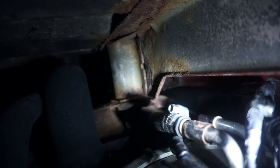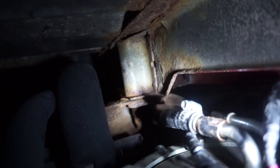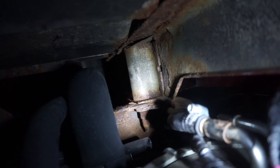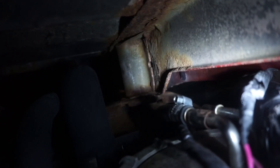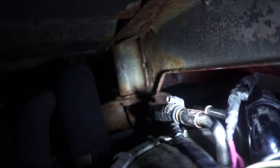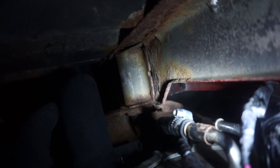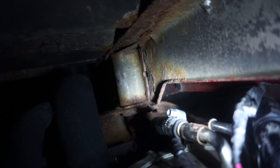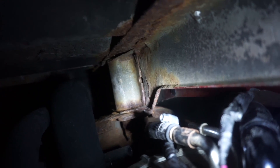What I did here — there was a 5/16" on the other side. I took the return line and put it back on the 3/8" side. I clamped it down; it should be good enough temporarily. What I'm going to do now is go test the fuel pressure, because it's on the 3/8" side now, not the 5/16" side. Before, I just took that 3/8" hose and put it over the 5/16" barb — it went right over, jammed it on, clamped it down, and never thought about it again. That might be my problem.